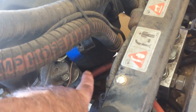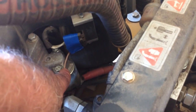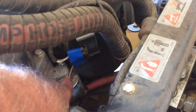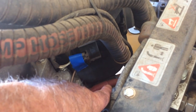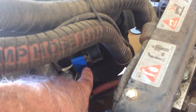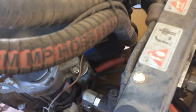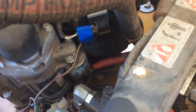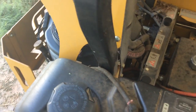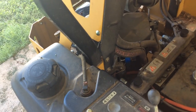I looked and there was a dirty wire right there — the brown one — that hooks into the rectifier. That wire was hanging over here and I couldn't see the end of it, so I didn't know it was loose. But I saw a loose connection here, put the wire back on, and everything was good.